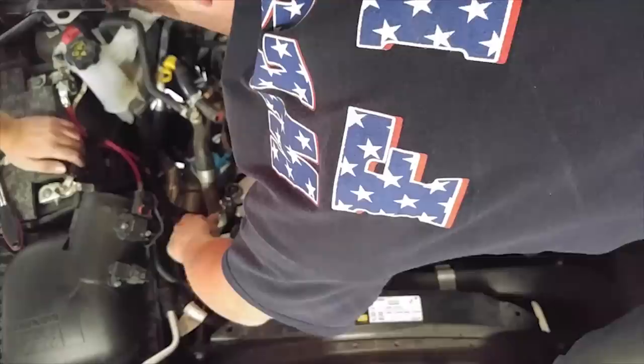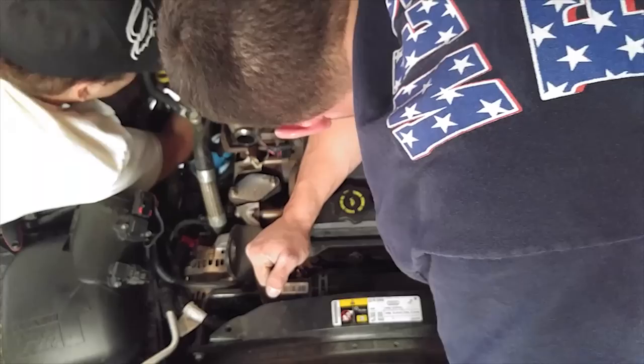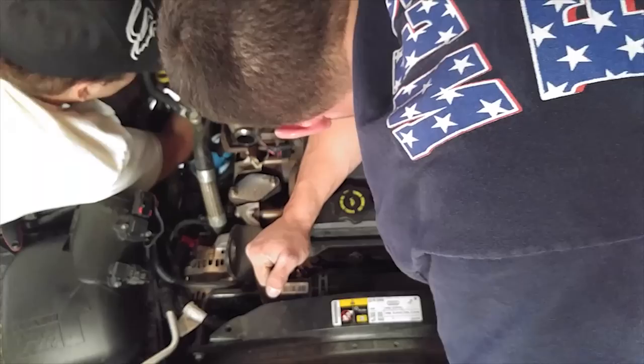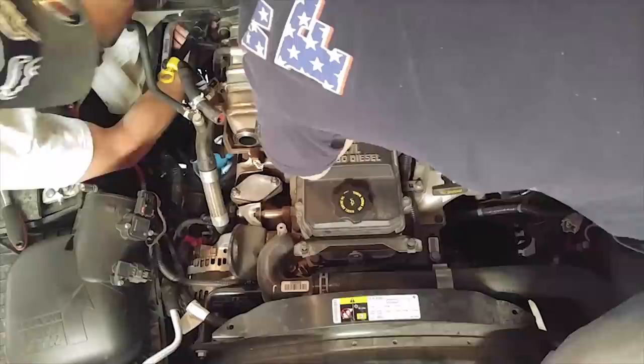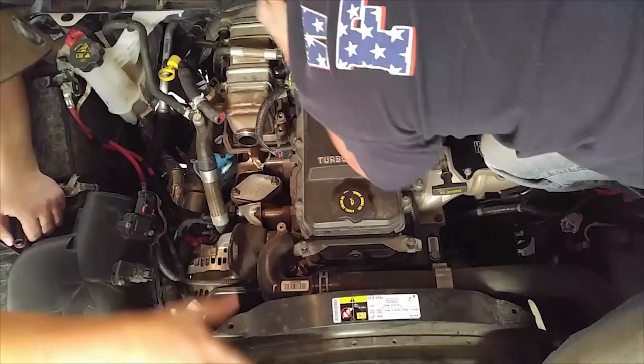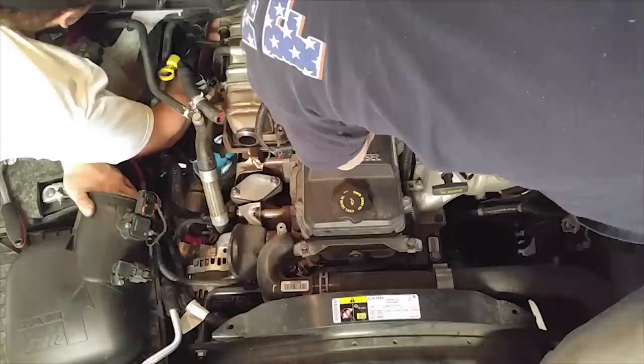I did get transmission tunes along with my engine tuning and I definitely recommend it — it makes the transmission feel completely different and removes some of the stock trans tuning errors. I also run a 12-valve tune for a little better fuel economy, and it makes the truck sound like an old 12-valve or 24-valve with that classic tractor sound. On my next video I'll show you how to tune your truck with the EFI — I'll go through everything on the computer, the files, how to load it onto your EFI, and all the steps to tune your truck.